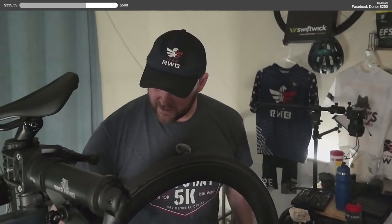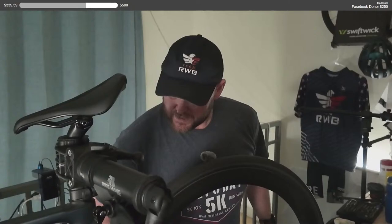Cross-chaining is not good. It usually sounds weird and feels weird and looks weird. It can put quite a bit of tension and strain on your chain, because that's the furthest extent it should be able to go, either of those extremes. But you should, design-wise, be able to safely operate at it.